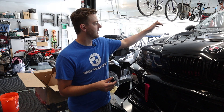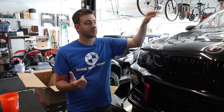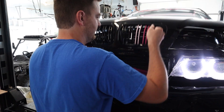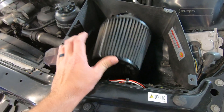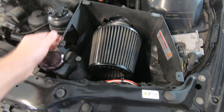Today I'm also removing the air intake and intake manifold — you don't actually have to do that to install this kit, but we've got the original CCV system in there that needs to be removed. Since we're running a catch can and I had chopped some things off of it, we'll make sure to run the fuel regulator onto boost now that it's not vacuum anymore. The fuel regulator vacuum connections, which used to be on the driver side, will now be over on the passenger side. This will be a fairly side-by-side install to the instructions with just a few differences. Let's get the hood popped and start the install.